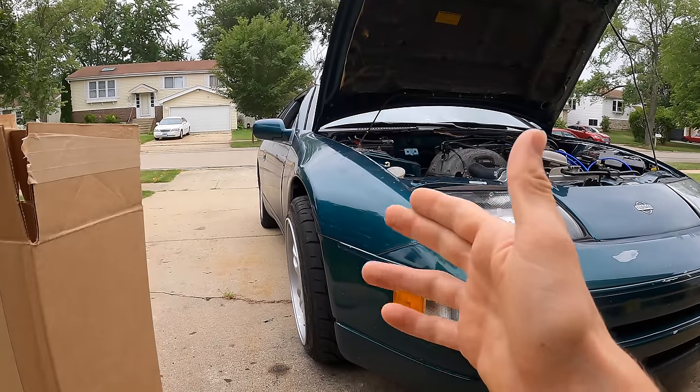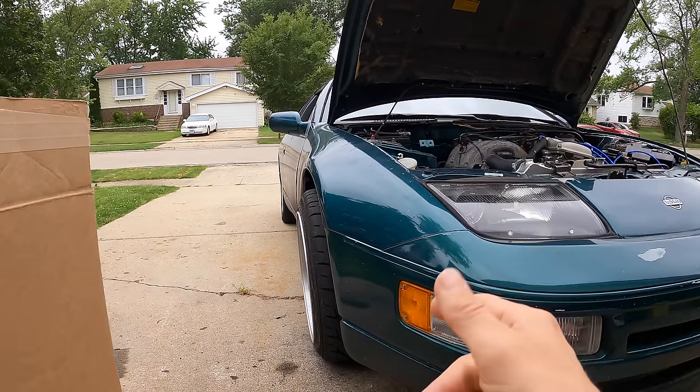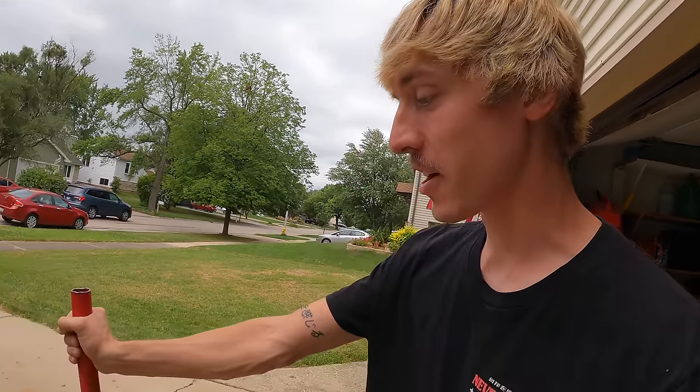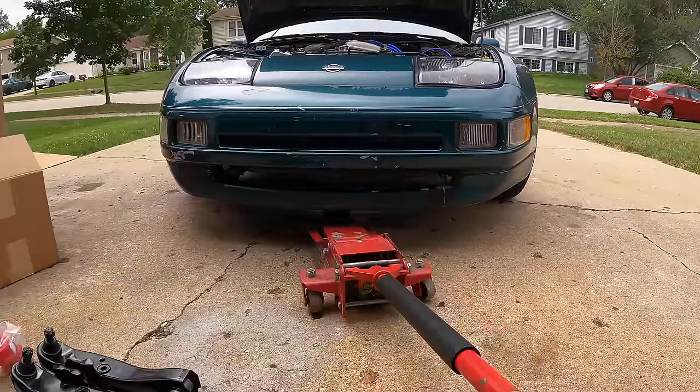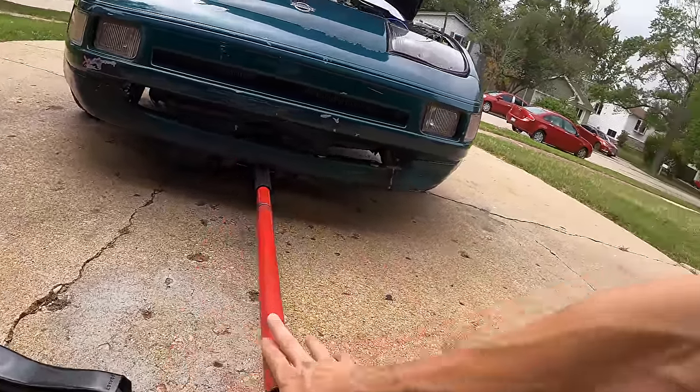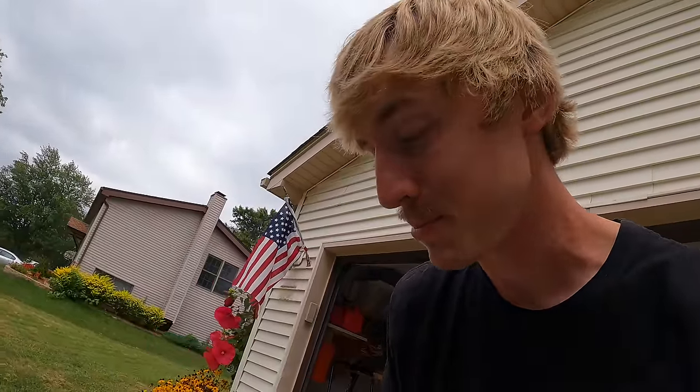but before I do that, I'm going to slam the car to the fitment I like, because I think the fact that it's raised so high has to do with why it's positive. Because when you lower a car, it will naturally have negative camber. This will probably be my last time jacking the car up directly from the subframe without using any wooden blocks to drive on. I'm ready for the low life problems.